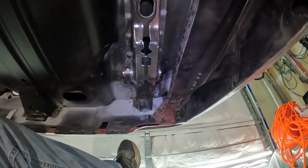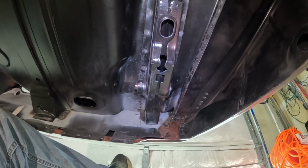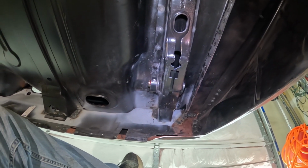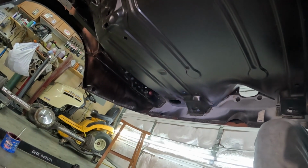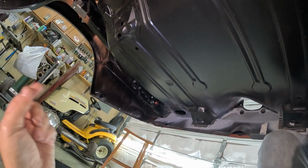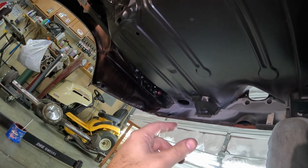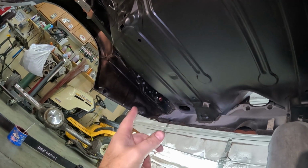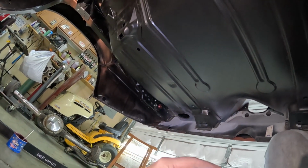For you guys who have lathes, it would be an easy fix. Super simple. Chuck it in the lathe, take a few thousandths off, and it'll pop right in. But you still want that interference fit. What I ended up doing was, I have an Eastwood SCT, the surface conditioning tool. Pop the drum off, slid on the bushings, very haphazardly taped them in place, and took some 80 grit sandpaper and just sanded them down till they fit. Which led to other problems.